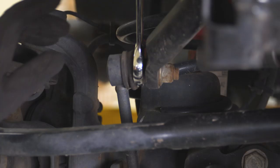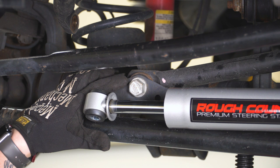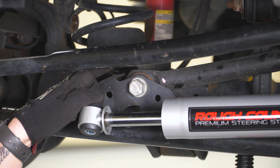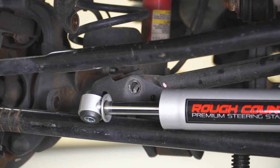We're going to repeat that same process with the top stud — 18-millimeter deep socket and the 19-millimeter wrench. Now, in order to allow our axle to drop low enough to get in our taller spring, I am going to disconnect the track bar at the axle side using a 21-millimeter socket. I also had to disconnect our dual steering stabilizer using a 9/16-inch socket and 19-millimeter socket and wrench to have enough room to remove that bolt. Once the axle shifts, we'll be able to lower it enough to get our new springs in.